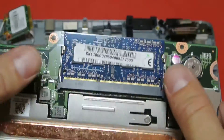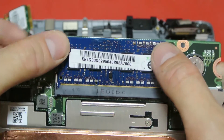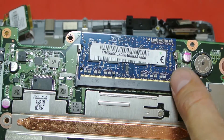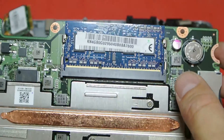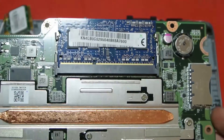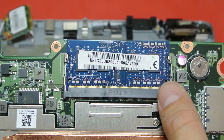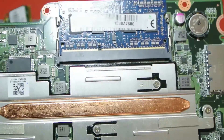Here is the main board with the fanless design. You can just pop the RAM chip out and then replace it with your new stick. Make sure you put it in properly — if the stick isn't seated correctly you'll get a black screen and have to take it all apart again. You can upgrade to DDR3L 8GB; make sure you get the low-voltage version or it won't work.